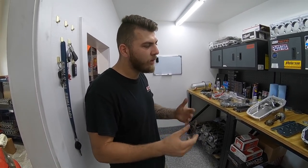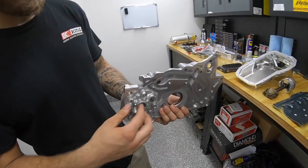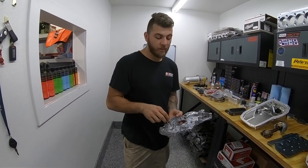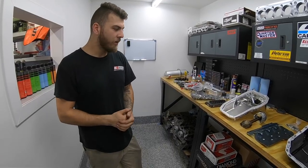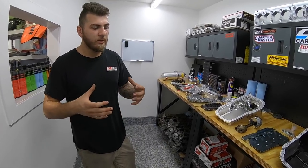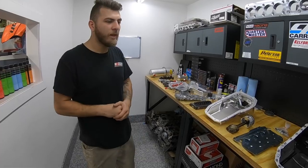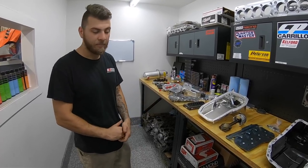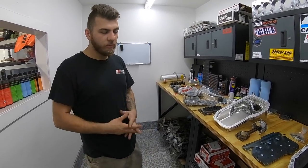The real question is: why do people upgrade their oiling system? The 4G63 oil pump from the factory, housed in the front cover, is very sturdy. We've run these up to 9,500–10,000 RPMs and they usually don't have any issues. On engines like the RB26 where the oil pump is driven off the snout of the crankshaft, two-stepping hard can break gears — but the 4G stuff we haven't seen that as much.